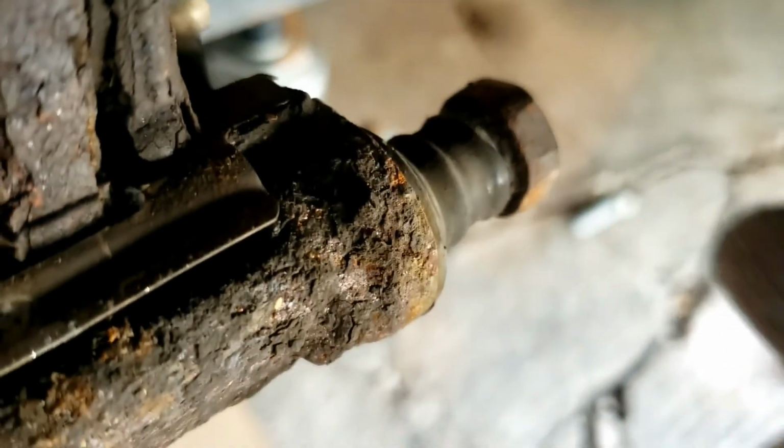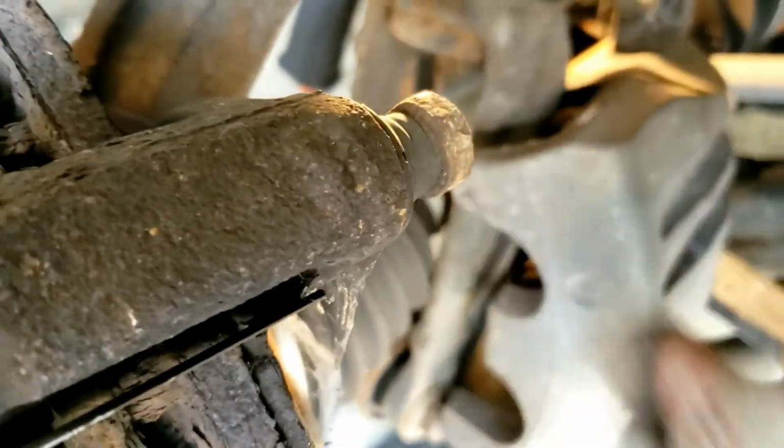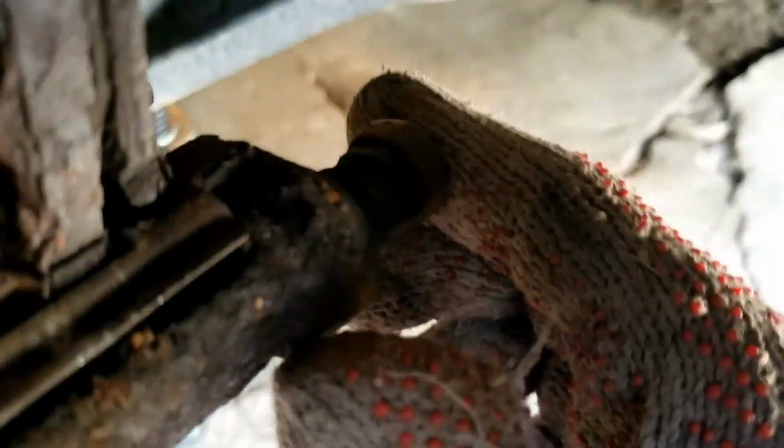Next, check these sliding glide pins. Very important. You want to make sure they can easily move back and forth like that. In case yours don't, you literally just pull them straight out, clean them, put a little grease on them, and put them back in. There we go, that's one. And let's grab this one. There we go. They came out very easily.